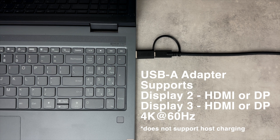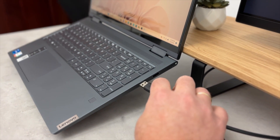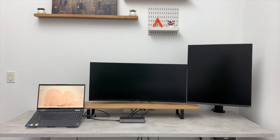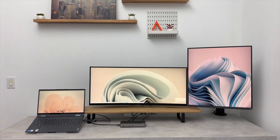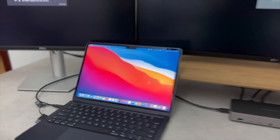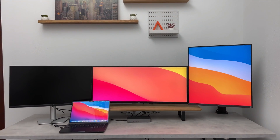For Windows devices that have a USB-A 3.0 data port available, you may connect the triple 4K display docking station using the included USB-C cable with the attached USB-A adapter. Users will have the ability to use the Display 2 and Display 3 video groups as long as the DisplayLink Manager software is installed and running. For Mac M1 and M2 users, the triple 4K docking station is a game changer, as it allows them to surpass the single monitor limitation of the M1/M2 processor and maximize display options with up to three connected screens.